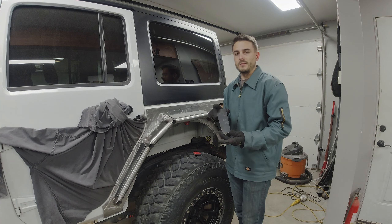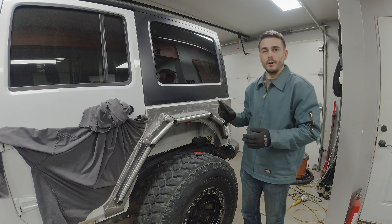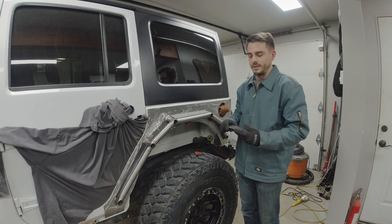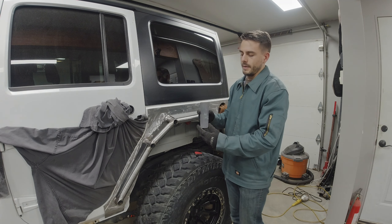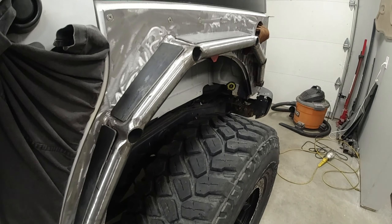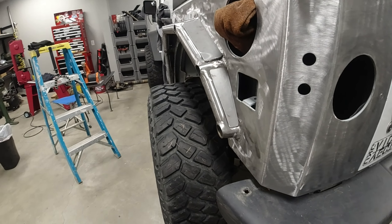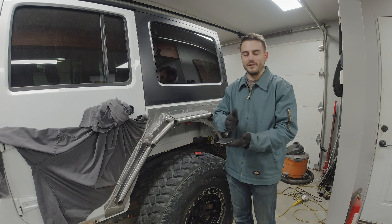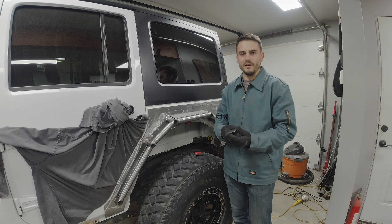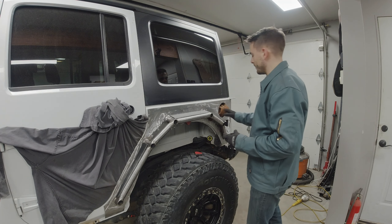They should really work out to be the exact same if everything is symmetric side to side, but I'm just going to be cautious before cutting those other pieces and potentially wasting material. I'm pretty happy with the appearance so far. Each piece is cut out with the respective angle. My Harbor Freight Horizontal Vertical Band Saw definitely worked out to be a very useful tool and made this process way easier — I got very straight lines versus the wavy results I'd get with an angle grinder or jigsaw.